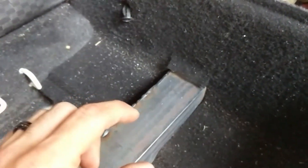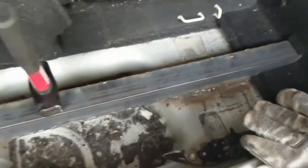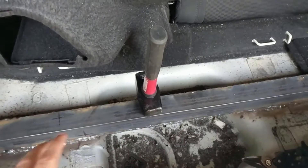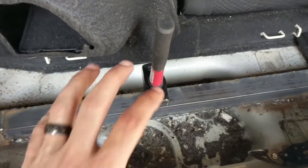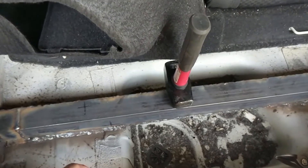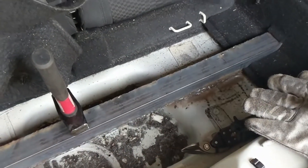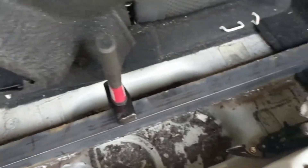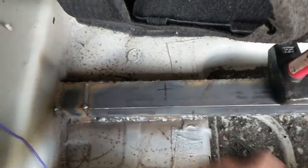Currently it's using maybe like a bottom inch of the frame and the frame is probably like five or six inches tall. All the way across fully welded through, and I did weld in the sheet metal on the bottom even though that doesn't add strength significantly to the beam itself - it does add a lot of rigidity to the floor pan and is just going to help stiffen up the chassis even more. And of course it holds up our differential. Last thing is going to be drilling holes to access the bolts, which we have marked there.